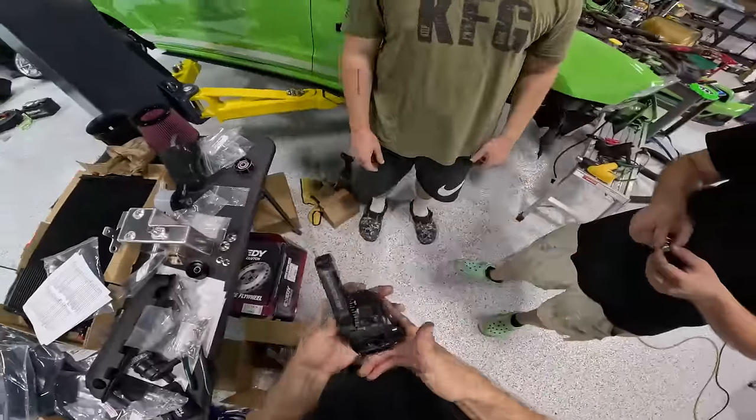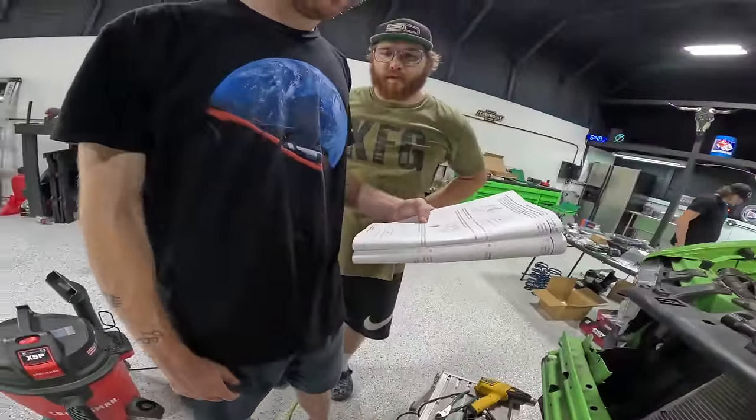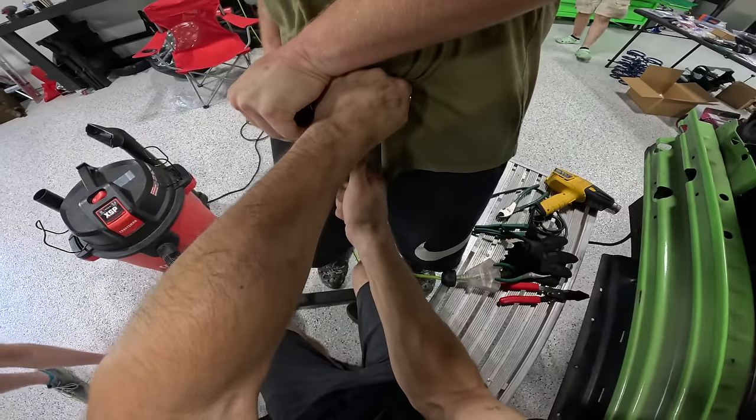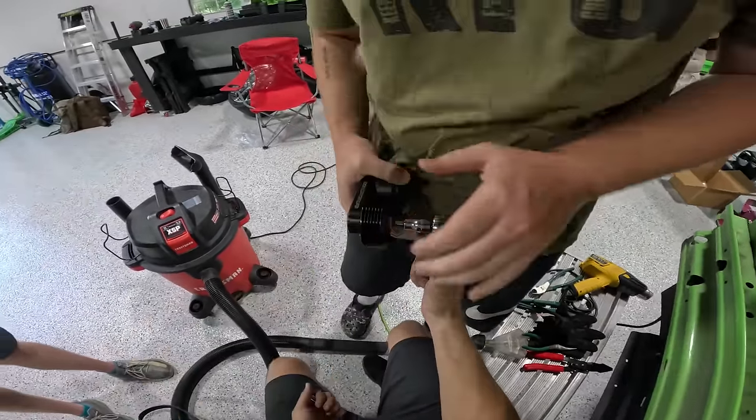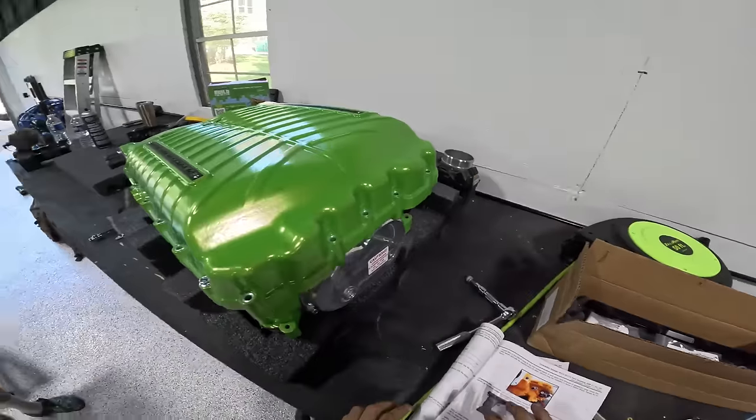There's a tensioner. Right. Dude, this is such a sick tensioner. Danny, would you want to torque this to 18 foot pounds? I can try. Take it slow though. That's probably tight enough. That's 18 foot pounds, I'm pretty sure. That's good. All right, next up, we literally pull the lid off of this blower.